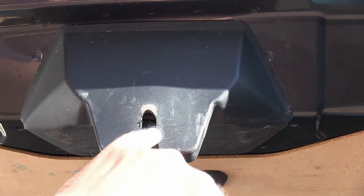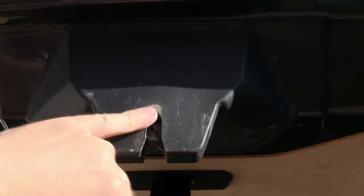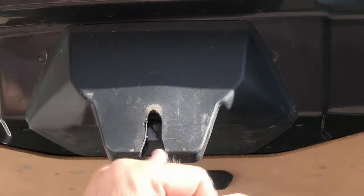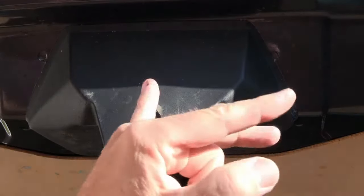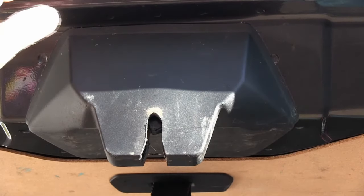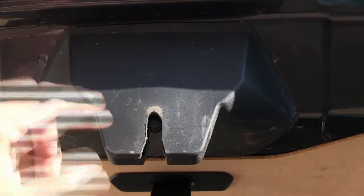The lock is now in the closed position even though the door is open — that's what we've managed to do with the key. There's a bar across here, and as I said, if you accidentally close it and forget, that bar on the bottom part of the lock is going to smash into there. To release the lock before closing, just operate the button just above the rear number plate, and that will open the lock up — now it's safe to close the door.